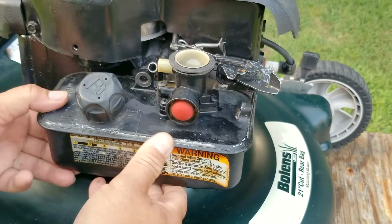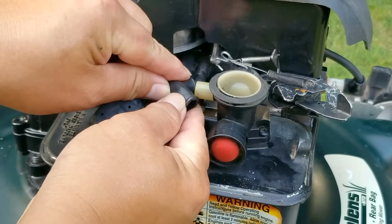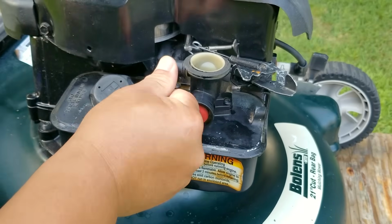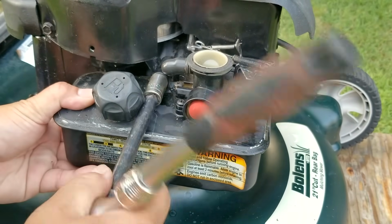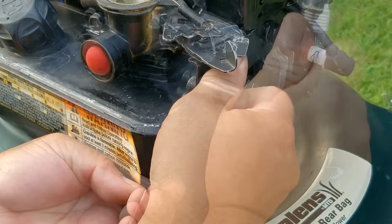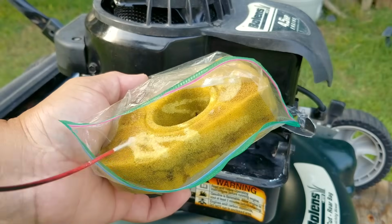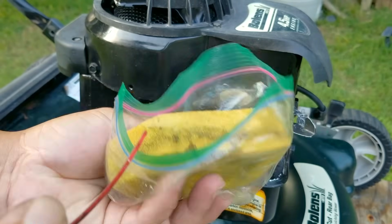Now at first, I didn't understand why the fuel tank was rusting out because it looks like it's made out of aluminum. But come to find out, the top part is bonded to the lower part, which is made out of steel. It's funny because it only took me decades of working on them to realize it. I'm also replacing that missing bolt for the front of the fuel tank, and hopefully it'll keep the tank from vibrating too much while the engine is running.